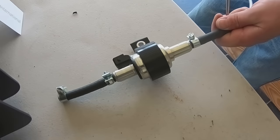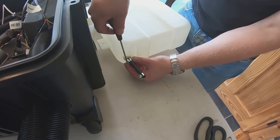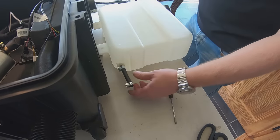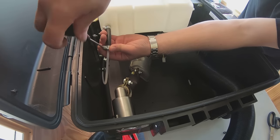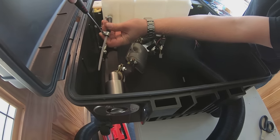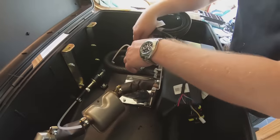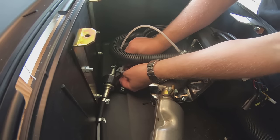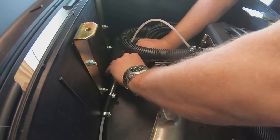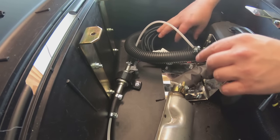It's easier to do this outside of the case — that's just attaching the rubber and the line to the fuel pump, and the rubber to the fuel tank. Simple flat-headed screwdriver, tighten it up until you can't go anymore. Be careful not to strip the thread. The electrics come all coiled up; we left it that way because we need it short. We're plugging it into the fuel pump and that will go directly to the heating unit. We will cable tie the loops of cable secure so that it's not bouncing around inside the case when we're driving around.